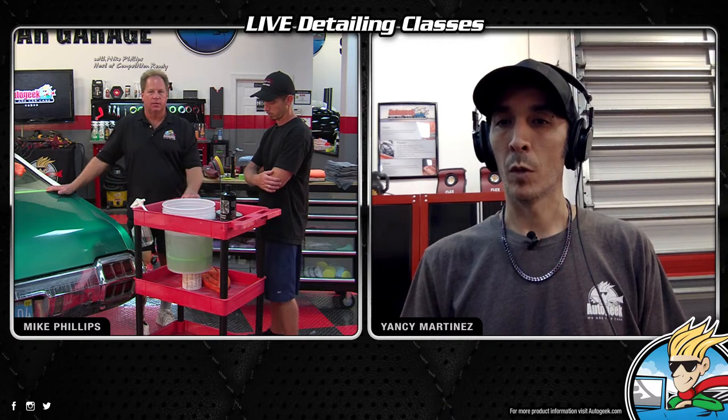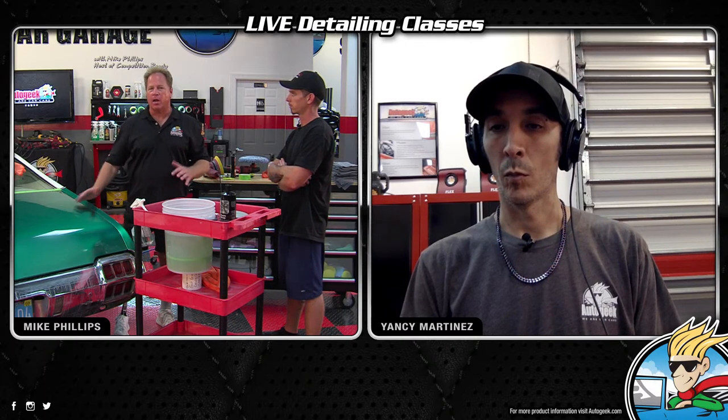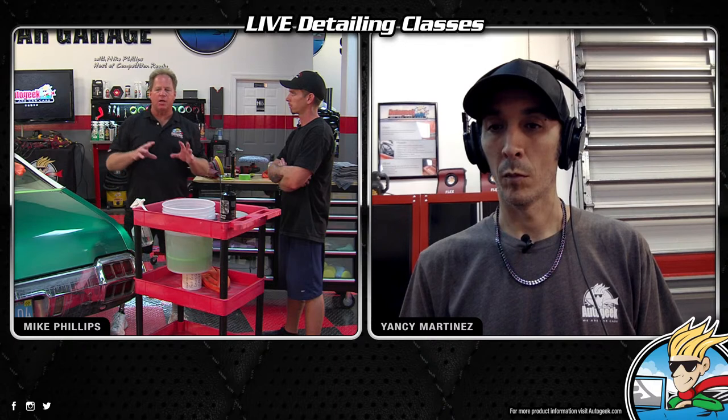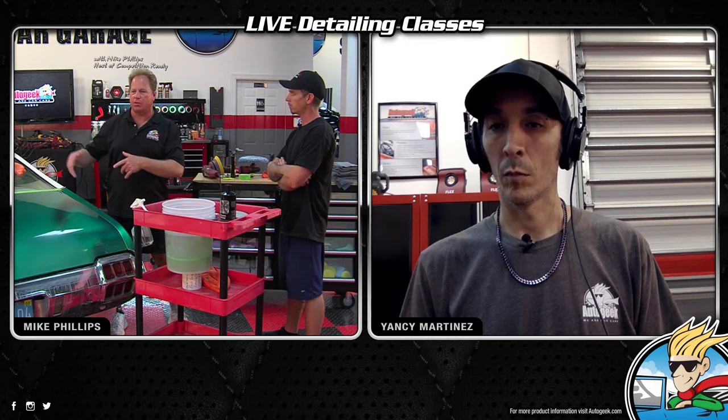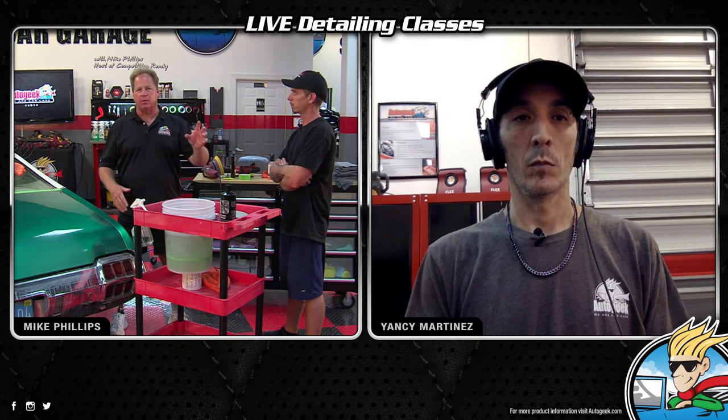Okay, we have Benji Davis. Hey, Benji. Mike, there is a big debate about whether IPA diluted with water swells the paint. Some swear by it and some scoff at it. Please elaborate. I'm the guy that actually wrote the original article on how to dilute IPA to chemically strip paint to visually inspect it and see that you got all the defects out. What I say about that article, and it's in my first book, is I never wanted to write it. I'm not a big IPA fan. I like to buy a product that was actually formulated by a real chemist to do the thing I want to do. IPA is for people that want to be cheap: go buy it at your drugstore for $4 or $5 for a 60-ounce bottle and mix that with water. It's a cheap way to create a solvent, and it's not even a very good solvent.